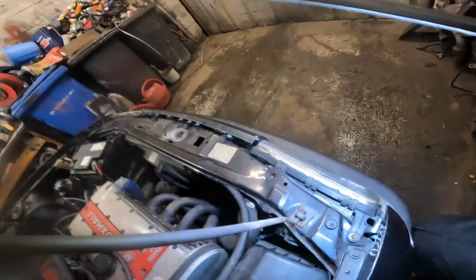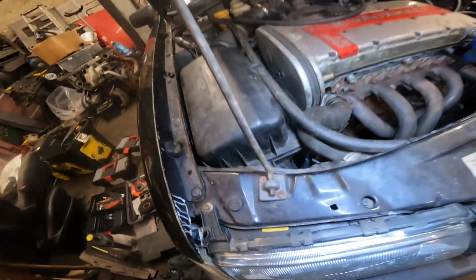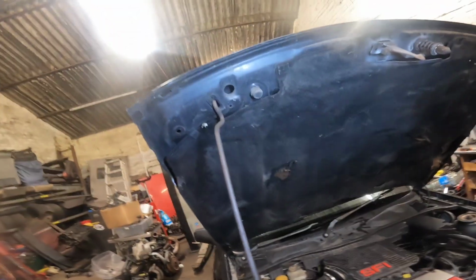And I've also connected the bonnet catch in as well because it kept popping out, so it's in there properly now. And I've just replaced the stay for the bonnet because the one that was on it was bent and rusty. But I'll keep that because they're good. They're ideal these for making exhaust hangers up. So that's in there now. So we've done 6 things, which is good.